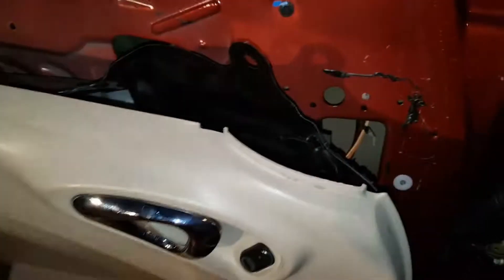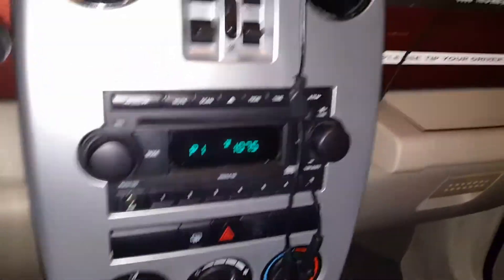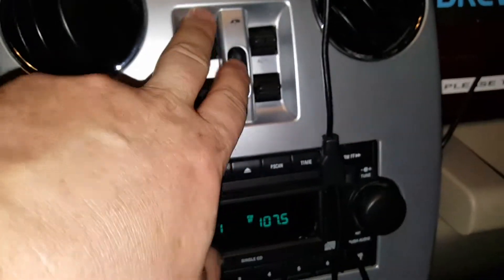I'm working on this right now, but I had a video earlier where the passenger door window wouldn't open. I haven't worked on that yet, but I was pulling out the whole panel here — which sometimes it can be the switch panel. I thought it was a switch, but it turns out it was a wire that was loose on the motor.